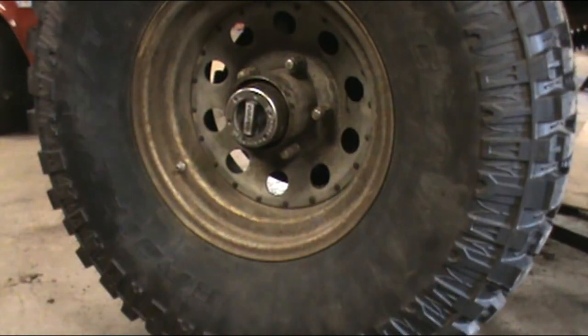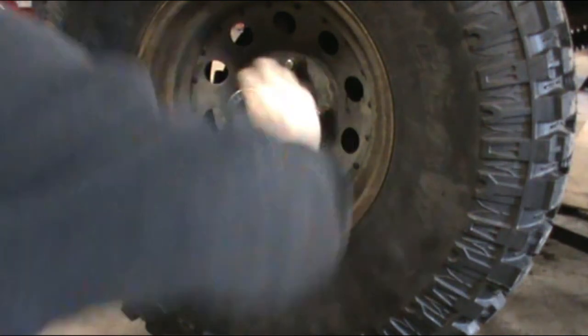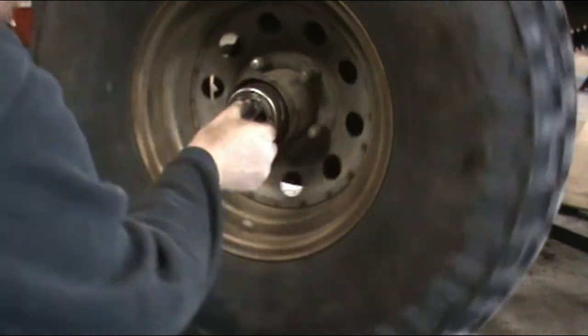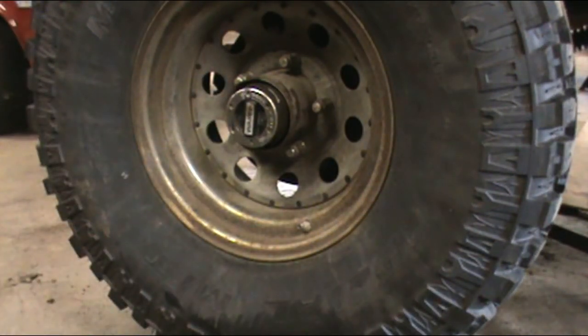Hub works. This thing has a spool in it. That's why I keep breaking front axle shafts. But the nice thing about that is if you want to see if your hub's actually lined up and everything, you spin the wheel and it locks. And now against that axle on the other side. Great for off-road, horrible for axle shafts. Boy, this thing freaking eats them.